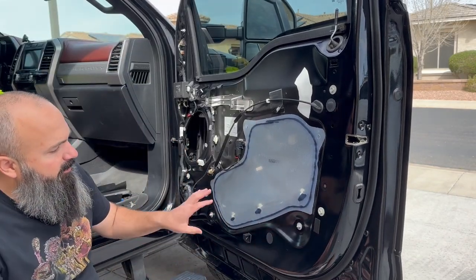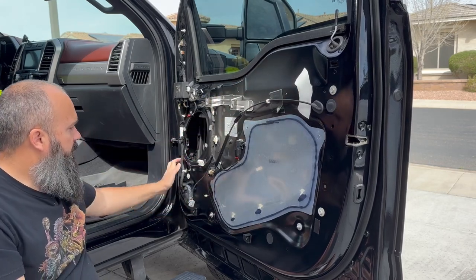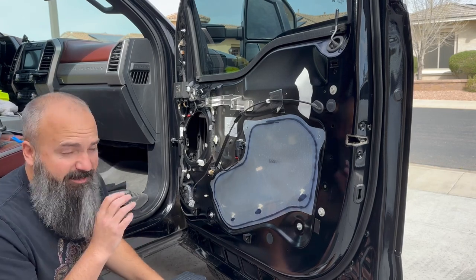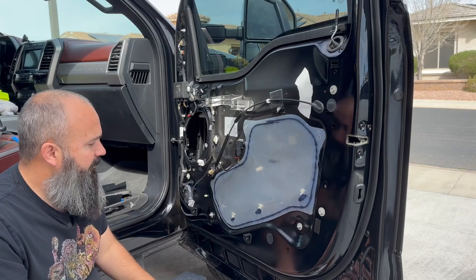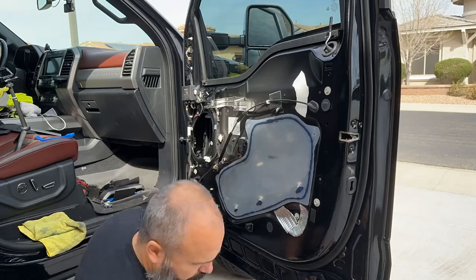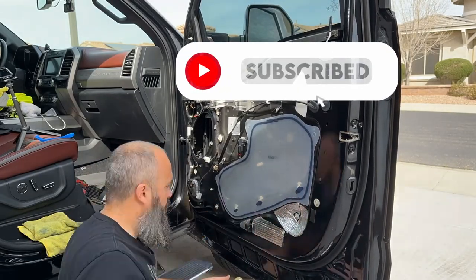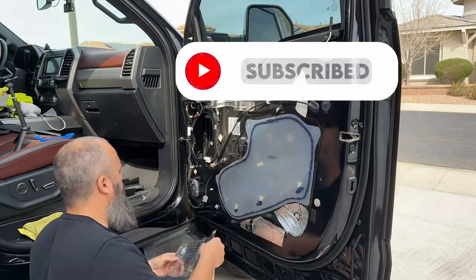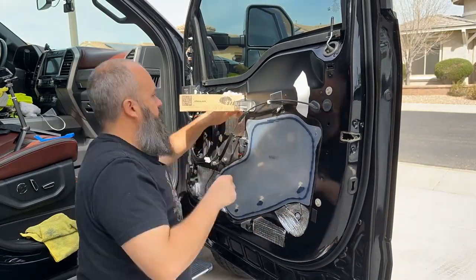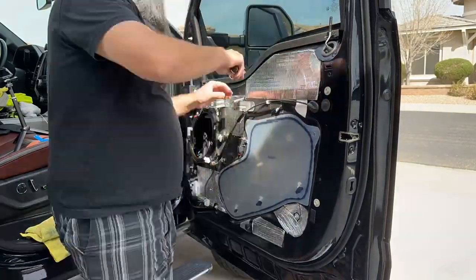This step is totally optional — I'm going to add sound deadening around on these hollow panels just because I think it will help even just a little bit. I can't stand rattles. I had this sound deadening material left over from another project, so why not? I went around the door, tapped on it, and just found every little spot I could get it to fit. While I was in there I also made sure that the vapor barrier was sealed up nice and tight — it actually had a couple of loose spots.